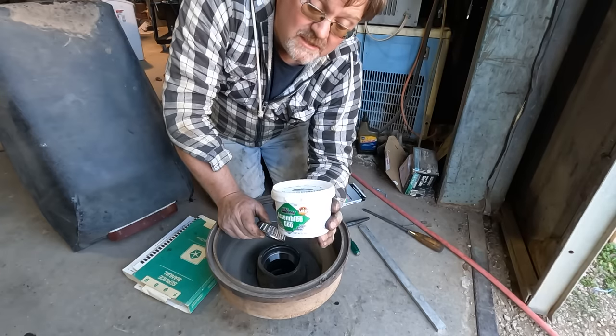I find it's a lot easier on my back to lift an axle from a little bit higher than ground level. I already had this axle fall off these jacks once, so always keep your hands up on top - make sure no part of your body is below so if it falls, you don't get squished. I'm using a jack on either side to try to maneuver it into place, moving them a little at a time, again trying not to get squished. I think it just dropped in - now we've got the axle in place, I'm going to go ahead and attach it.